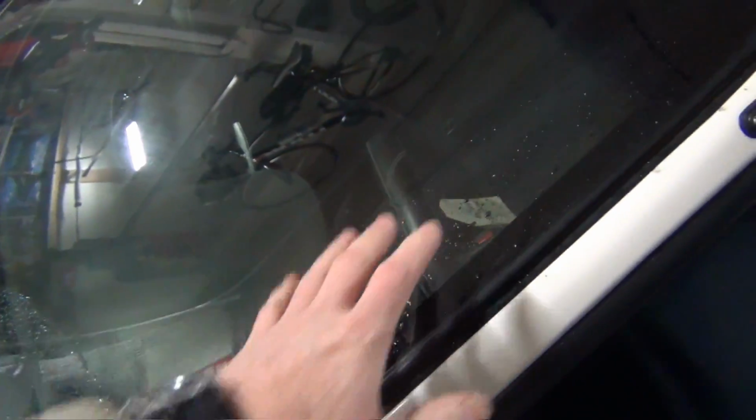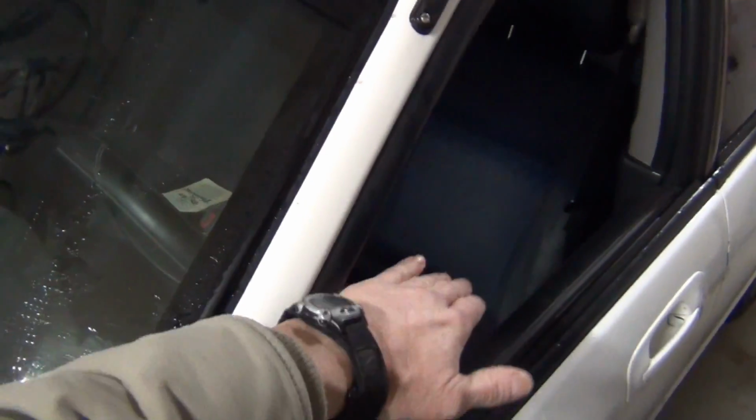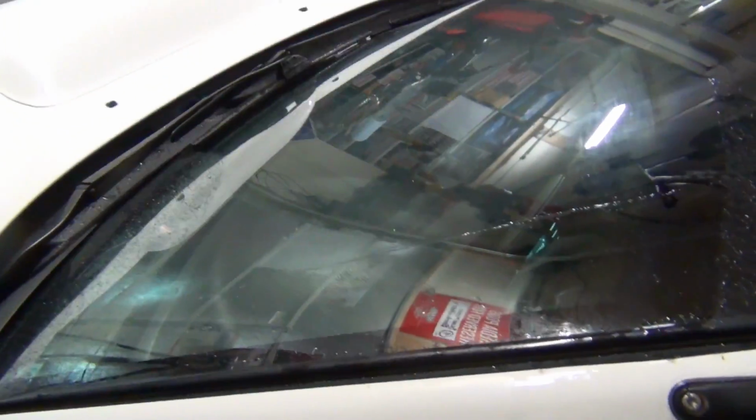You see, this is fine and it cleans the glass great, but if there's wind, the wind catches on this fin that helps create downforce and it moves it clear over the side like that. You see what happened there? So if you push a little bit of pressure here, it goes all the way off the A-pillar and gets stuck on the antenna. Let me show you, like that. And that's scary because when it rebounds, it skips most of the windshield, and you think it's going to rip this off, and it's just hard on it generally. So that's why we're going to replace the wiper transmission.